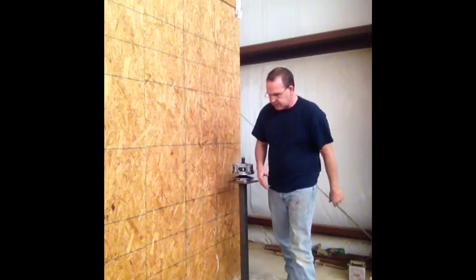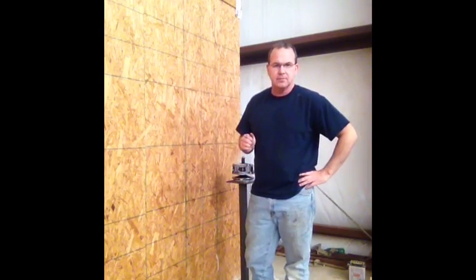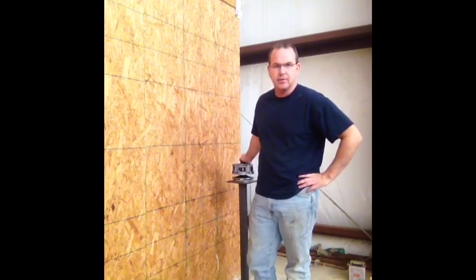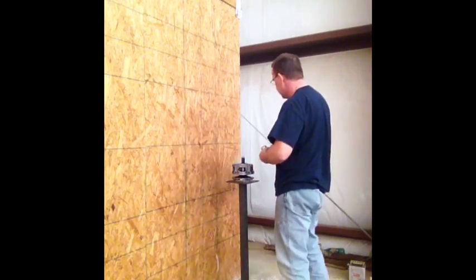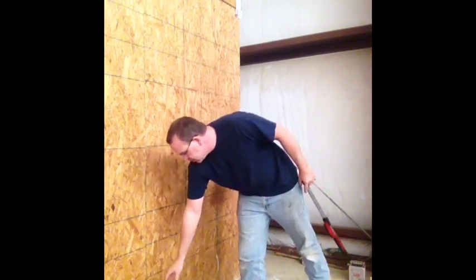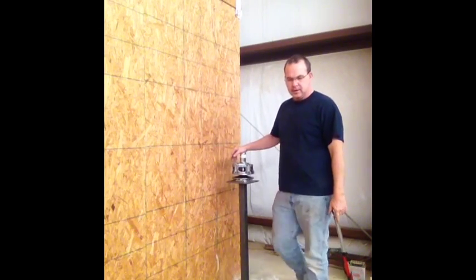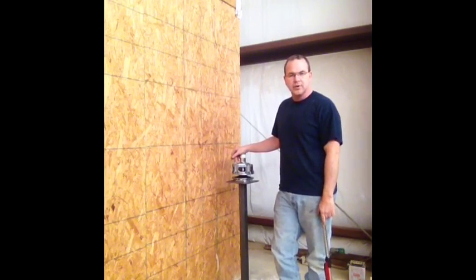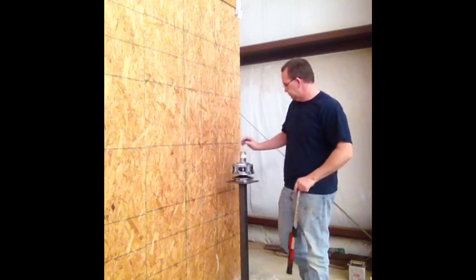I should have told you, and I forget this because I'm not actually doing it on this video, make sure you put Loctite on your threads before you put your spider back on. It'll be red Loctite. Alright, now we're going to torque the spider down. An 800 gets 200 foot-pounds and this 900 gets 280 to 300.